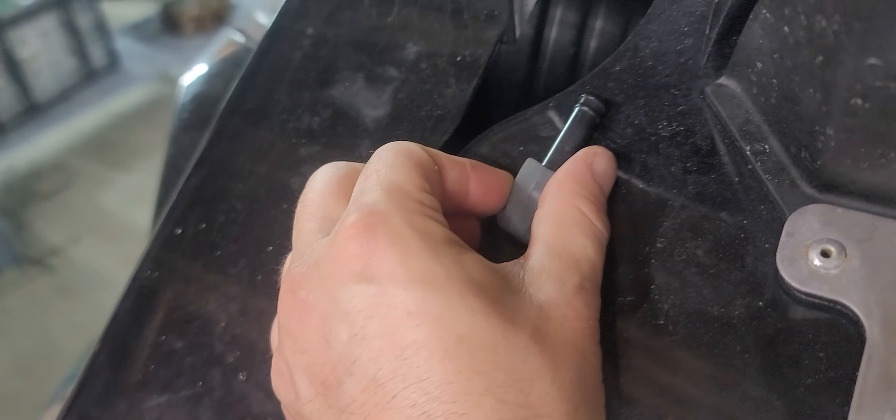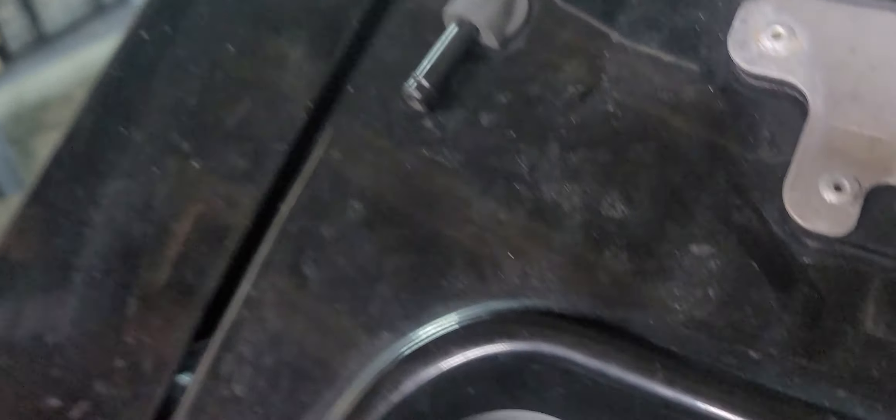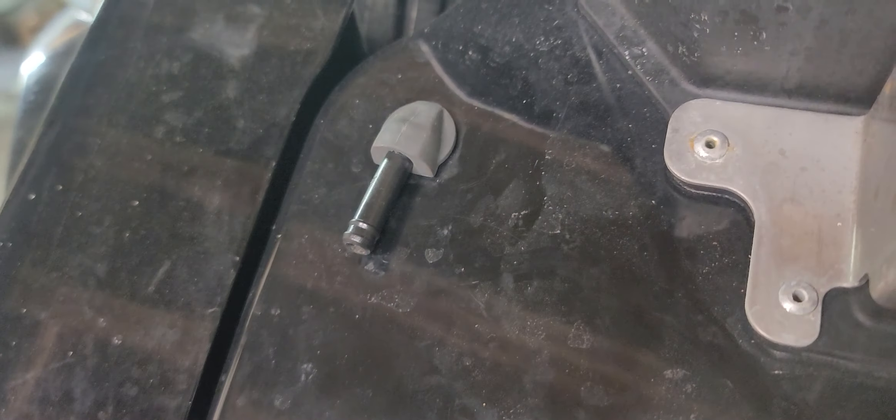You want to follow this hose all the way up and make sure it's not kinked. If it's not kinked and your hose was in this direction, I would highly recommend taking everything off, including the one-way valve, and blowing it out with air to make sure there's no debris and no water in there. That's going to be the first step.